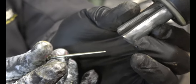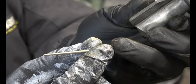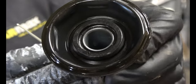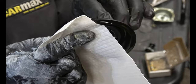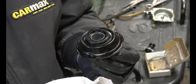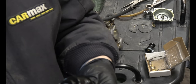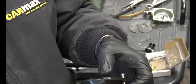If you've got a new needle that comes in your carburetor rebuild kit, just replace it. If not, you can just wipe this needle down with carburetor cleaner on a rag. If this diaphragm is moist like mine, just wipe it off with a dry towel. Don't spray carburetor cleaner on this. It will deform it. If it doesn't destroy it, it'll take a long time to reform back to the way it was. So it's easier just to make sure there's no tears or anything in it. Wipe it off, get the dirt off, and then we'll put it back in when it's time to put everything back together.